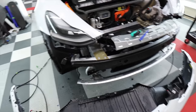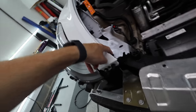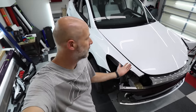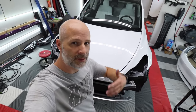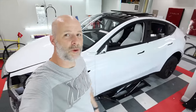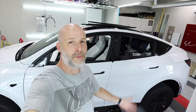There's a disconnect right here and the bumper's free. It's just a bolt here and a bolt here — headlight comes right out. Now you're ready to wrap. That is what I do to prep pretty much every car, even a black-on-black car. If I'm doing a black to matte black or something like that, I will prep it quite a bit like this — it just makes for a better wrap, and that's what I'm all about.